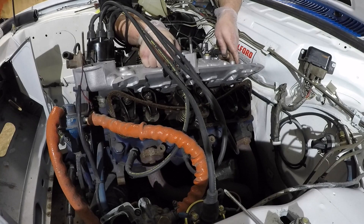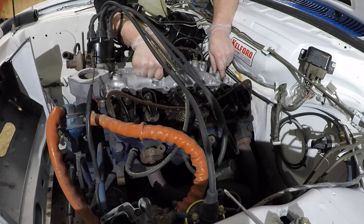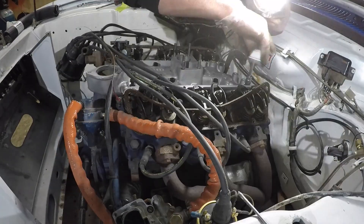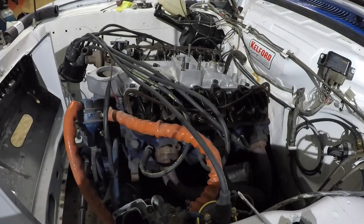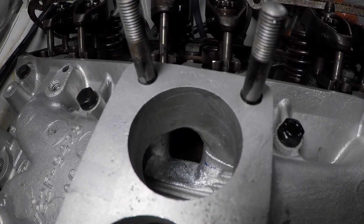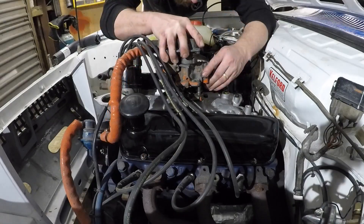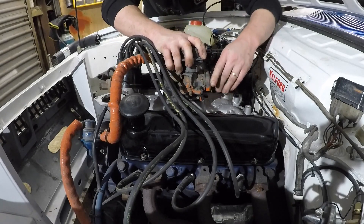This is where you want a reasonably clean drop so you don't just smear it everywhere — I'm trying to get it in around the distributor and then drop it straight down. When a plan comes together! Now we're really just into the final assembly, tightening it all down and keeping an eye on it to make sure I'm doing it evenly so I don't have that same gap as last time. You can see that lines up pretty well now — before we were off by three or four millimeters and we took that out of there, so now we're more or less lined up. I'll pop the carby back on and call the job done. There are still a couple of fittings and the thermostat housing to do but I need to go get a new thermostat, so we'll end the video there.